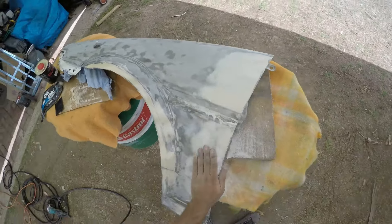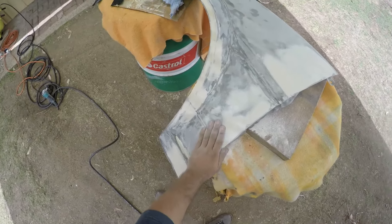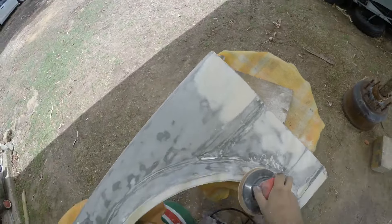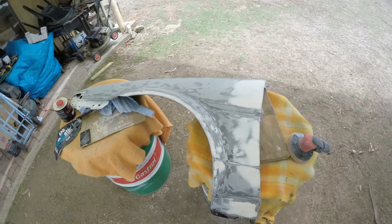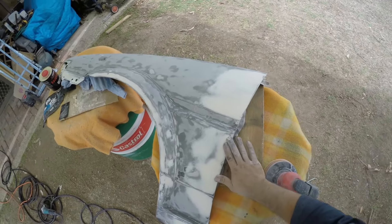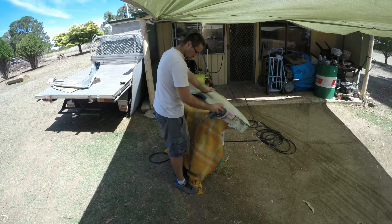I flattened it out pretty nicely — you can basically see through that filler. Getting this panel to a point where I'm just going to put a bit of epoxy primer over it, seal it off, and then I can really start focusing on shaping it and making it smooth. You can get a panel to a certain point, and if you keep sanding you're going to start going backwards — the filler sands at a different rate to the paint, and the paint and filler sands at a different rate to the steel. It gets to a point where you're not going to get it any better and you just need to seal it. The epoxy primer I'm using is also a filler primer, so when I'm sanding and shaping it I've got a consistent base to work with. I felt with my hand and made the decision that that's about as good as I'm going to get it.